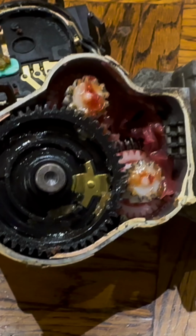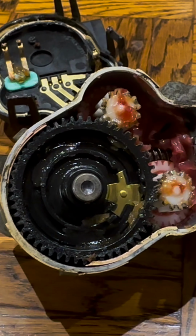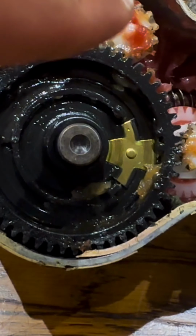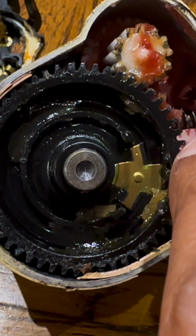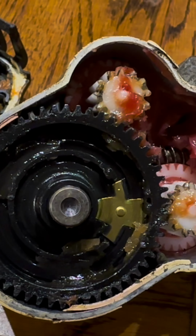This is the Nissan Qashqai's windscreen motor, which is completely failed. But what I've done is I've opened it up and I'm going to try and see what's actually caused the problem from it. So you can see all the grease is actually in there. There's almost like a worm screw there and it looks slightly bent. But what I'm going to do is boil away this grease, just apply some hot water on it, just to have a look and see what's going on.